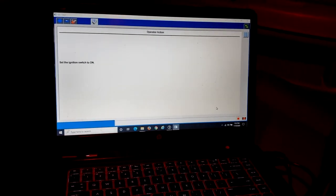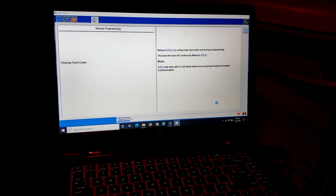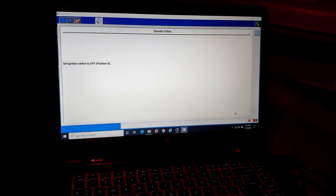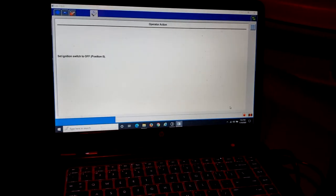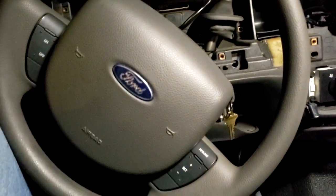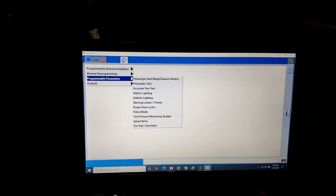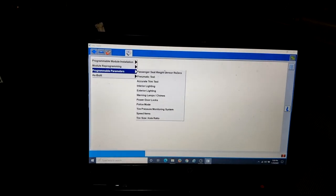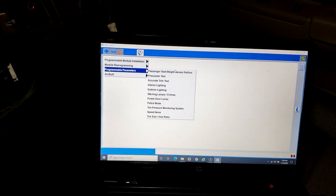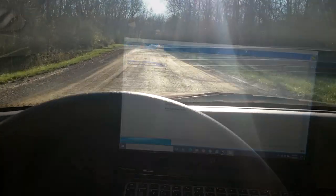Now I'm finishing the installation. IDS will go through a process of clearing fault codes that may have been created during module programming. It is a bit slower than using an actual Ford VCM2, but for DIYers it's worth it. If you can find a dealer that will do it for relatively inexpensive — probably less than an hour's labor — that could be worth it too if this isn't something you want to get into yourself.